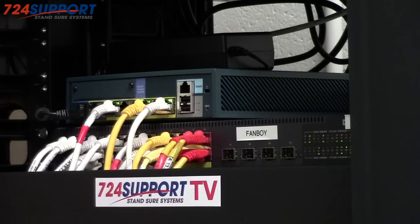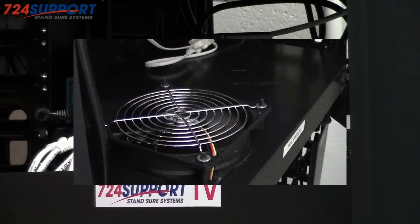For managed switches and PoE switches which require a lot of power and therefore heat, and you can't really replace them with anything that's not going to be loud, what we've done instead is replace their internal loud 40 millimeter server-class fans with externally mounted 120 millimeter quiet case fans. We have another video that shows how to make this mod. It works really well — we've got a couple of them. You'll notice this particular one is named 'fanboy.'